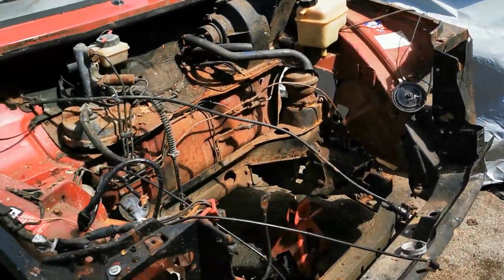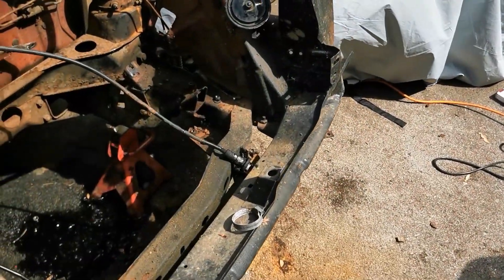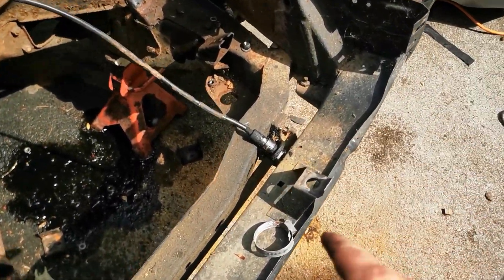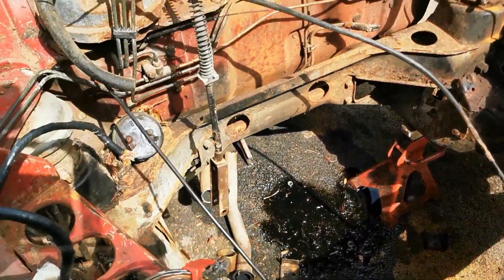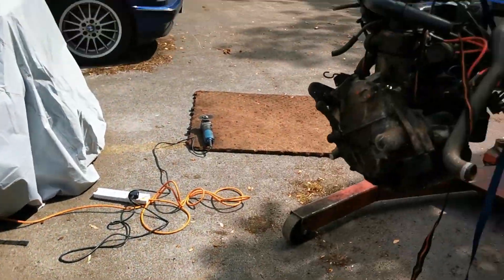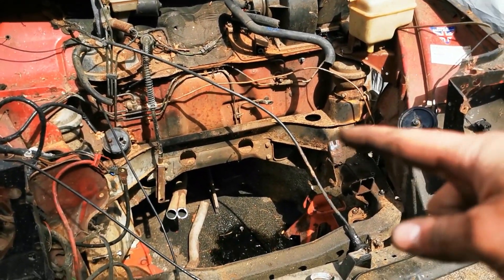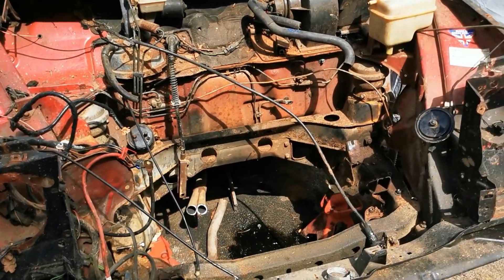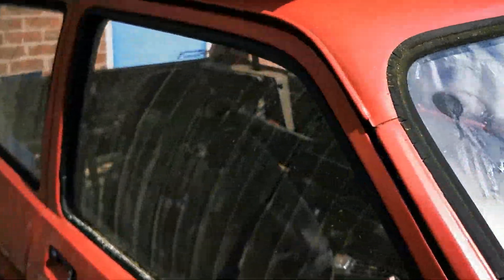It's out! So weren't too bad a job. I'd left two things connected which, to be fair, are specific to older cars — the speedo drive, which normally comes from the gearbox, and the choke cable I think it was. Other than that we're all good. So now obviously we've made room for activities, but this is all going to be fuel tank activities because the engine will be going in there.